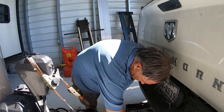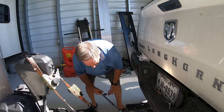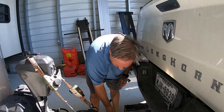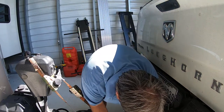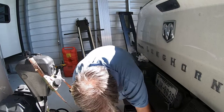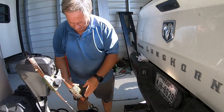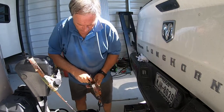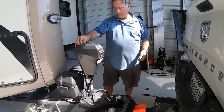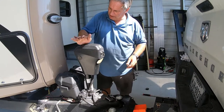Now I put my holders in, my bar, and it's going to close the gap. I put my keeper in, slide that on this side, put my bar in, and put the keeper in — the hitch is done. I go ahead and disconnect the socket holders since the hitch is now hooked up. Once the strapping is done, I take the little holder off and put the rubber plug back in so when I'm traveling it keeps the water out.